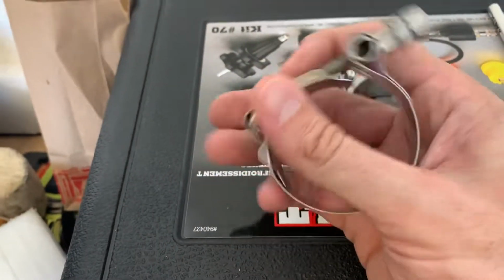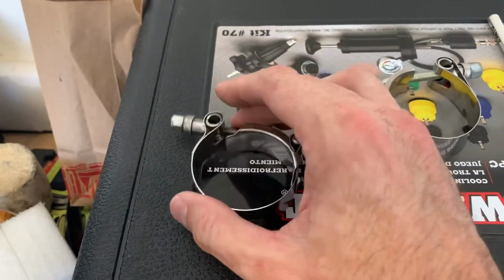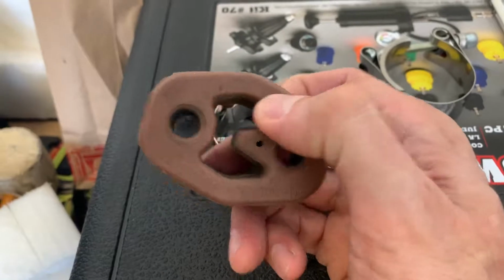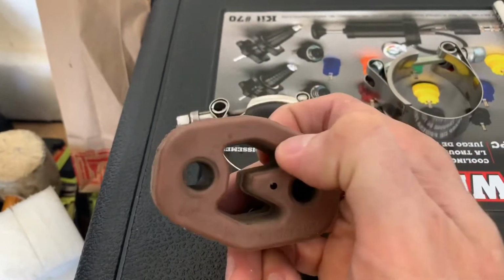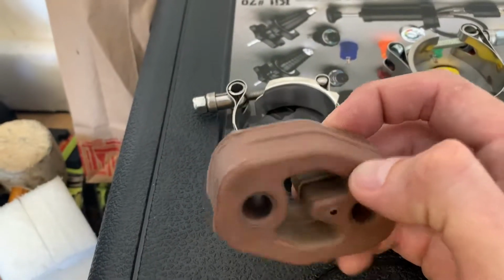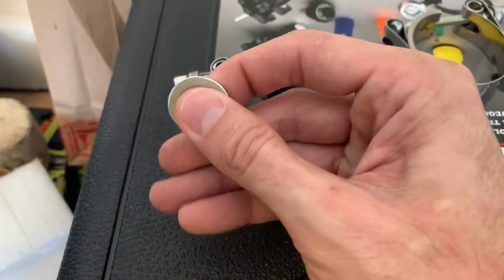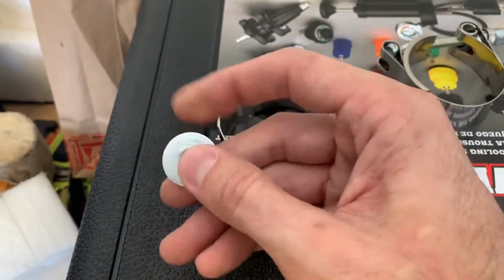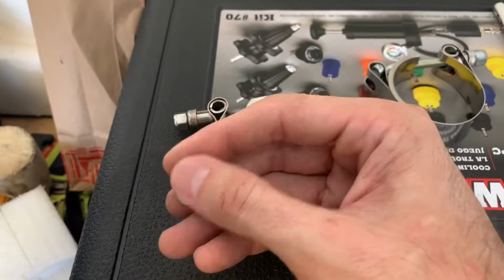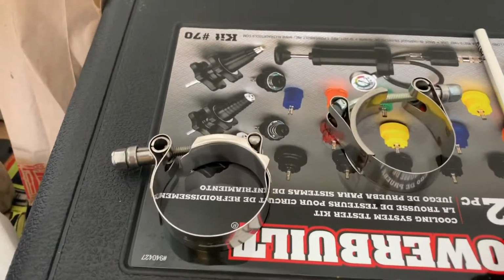My kit also didn't come with the grommet for the hard pipe on the hot side, and I ended up using one of the factory motor mounts, cutting this little flat chunk out, and installing that under the bracket. And I think it's actually more effective than the thing the Mishimoto comes with. I'm going to see if I can get a flat washer under the nut, since I have to loosen that up anyway, because what seems to be happening is it's pretty soft aluminum, and the nut's digging into the little tab already, so I'd like to put something on there so it doesn't tear.